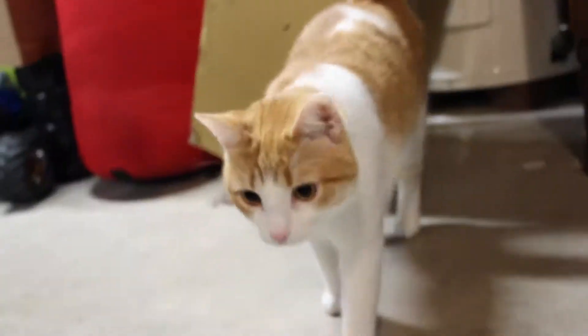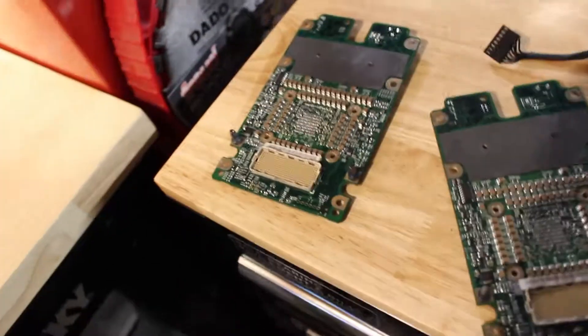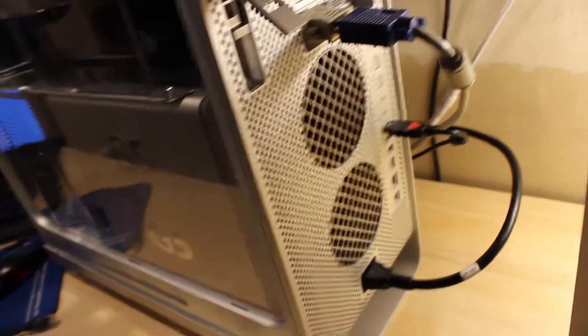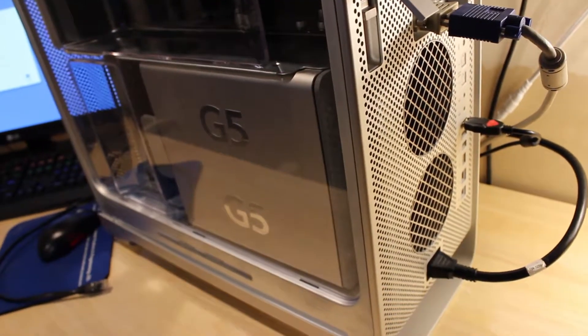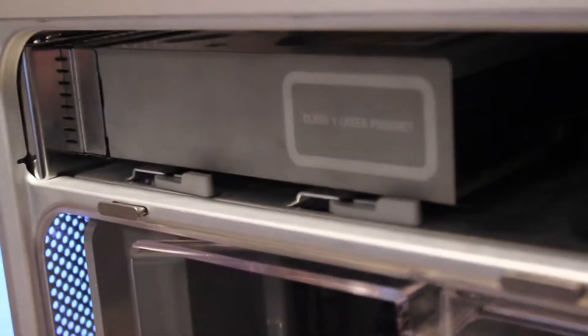We have a visitor — there's a cat! And that's all there was to doing this conversion. This 2.5 GHz dual processor G5 is now officially on air cooling. Those are massive heat sinks pulled off of the 2 GHz CPU cards, basically identical to the 2.5 GHz cards — I'm sure they are just locked to a specific clock speed. This was not the hardest conversion in the world but it was very difficult and very time consuming. I had to replace the optical drive too — that wasn't included in the video, it was dead.